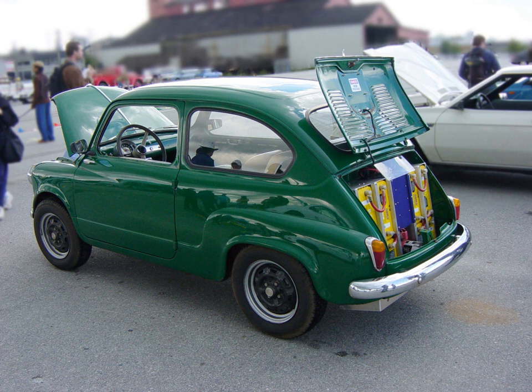The later MR2 body style does not seem as popular, and as of March 2008, there is only one known conversion. A 1983 Mitsubishi Starion was converted to all-electric in 2009 by Carmel Morris and Nathan Bolton in Australia. This sports vehicle had divided front and rear battery load for well-balanced, low center of gravity performance. The battery pack consisted of 45 × 3.2 V nominal lithium-ion batteries. The tare weight of the final result was not much greater than the original specification, allowing the sports car to be engineering road certified as a four-seat vehicle.